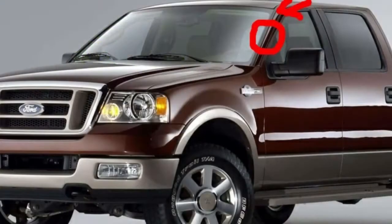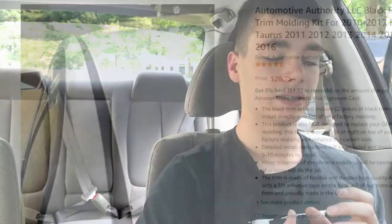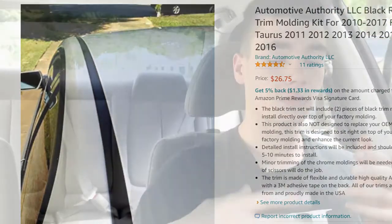A lot of times it's not just the sunroof drain or weather stripping. In the case of my dad's truck, on the roof there is a channel where water can flow, and there's an aluminum panel strip covered in plastic. You just slide it out — it has clips on the front of the windshield — and underneath it is a sealant between the seam of metal. The truck has 200,000 miles on it, so the seal had likely just gotten old, and what my dad and I did was RTV the whole thing. We fixed the leak and it doesn't leak anymore.